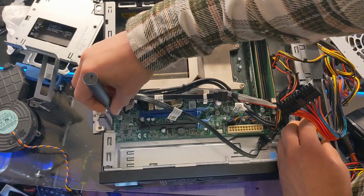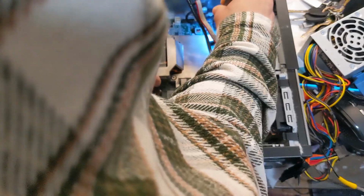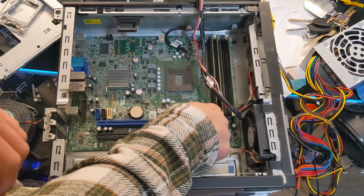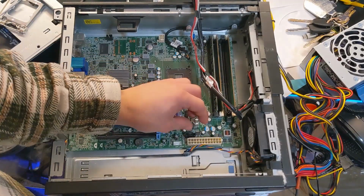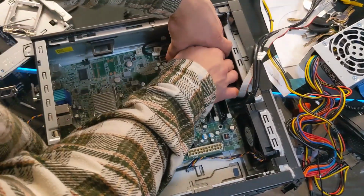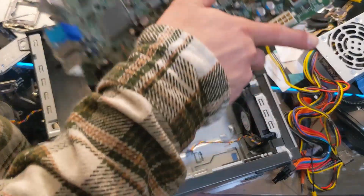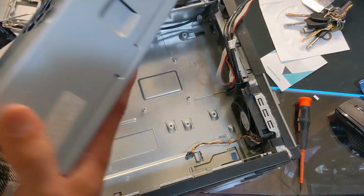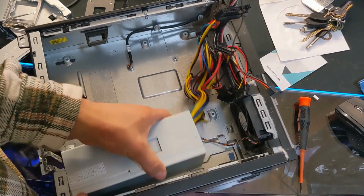However, even after removing all the screws, I still couldn't remove the motherboard to my surprise. So I then proceeded to remove the heatsink and even the securing mechanism to no avail. I was totally stumped until I realized that it was unobservant and I hadn't noticed that the standoff for the hard drive screws directly into the motherboard tray. So with a good chunk of time wasted and my efforts to preserve a little bit of thermal paste foiled, I removed the motherboard and attempted to fit the new power supply in. This is when I came to the conclusion that it wasn't going to be that easy.